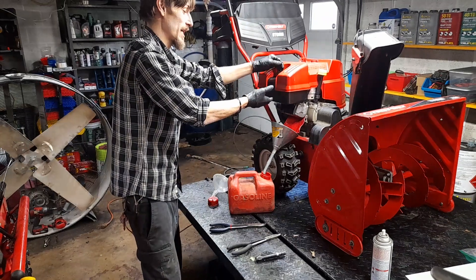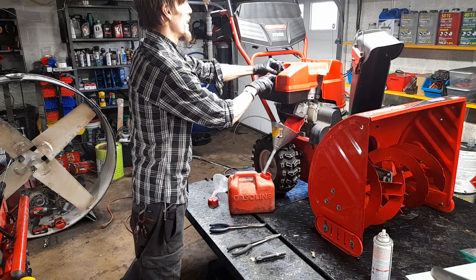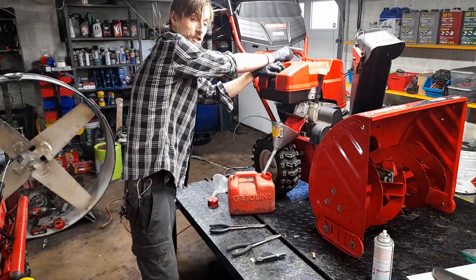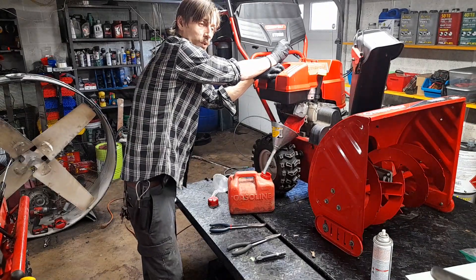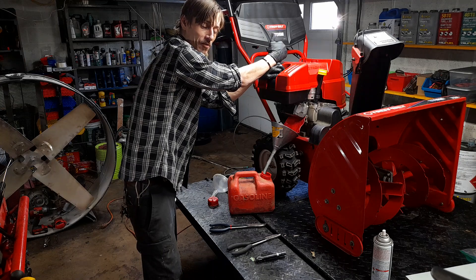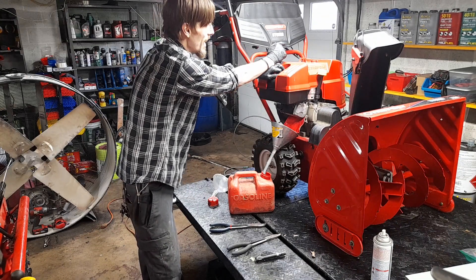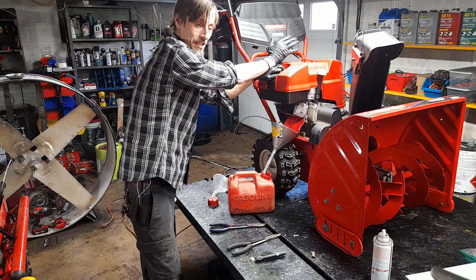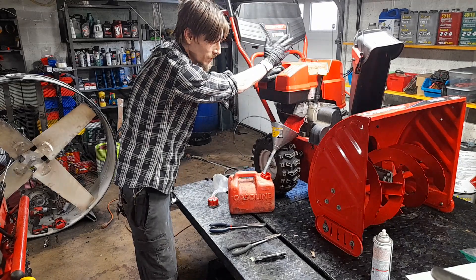This is what we call a soft flush — we're going to drain this, let it all clear out, probably blow it out with the air chuck to get whatever else we can. Then I'm going to refuel it with Aspen fuel or the 4-cycle TruFuel. Since this equipment runs just fine, I'll press the button on the float bowl to start refilling the carburetor with whatever ethanol-based fuel is remaining, then we'll run the equipment until it gets to full operating temperature to make sure everything sounds correct and in tune for how I'd expect it to run.